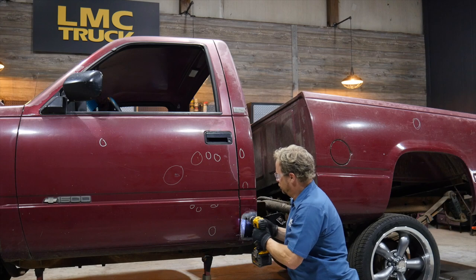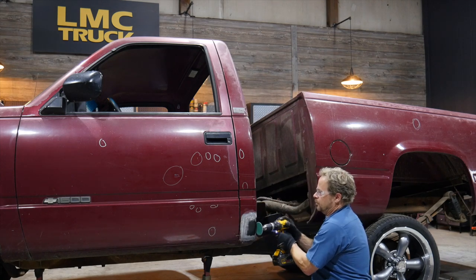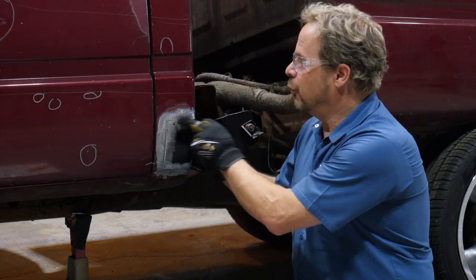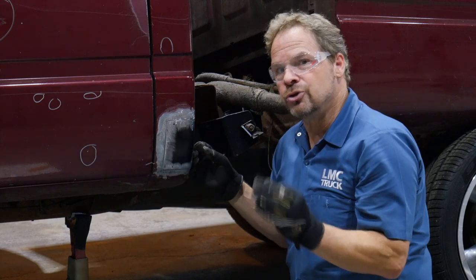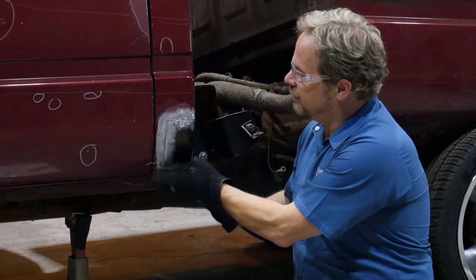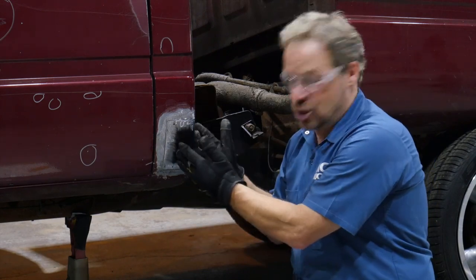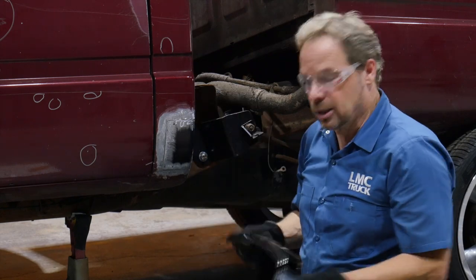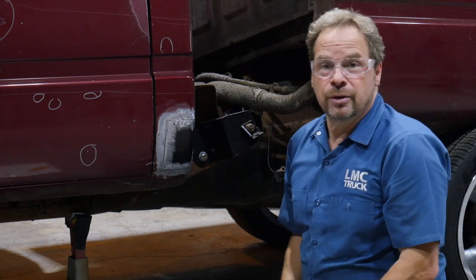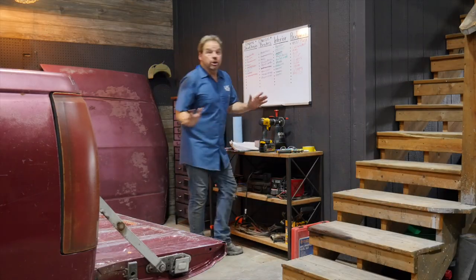After another solid 20-minute wait, we pulled the sheet metal screws out and, using our 24-grit disc on the drill, ground any excess adhesive off of not only the gap between the patches but also the outside edges. We still have to use a fiberglass reinforced filler for the gap, and you don't want to use your glue for body filler — it's not for that. It'll expand and contract differently and you'll see what's called a map through the patch. So we're going to use a fiberglass body filler here and for the little holes. I want to keep as much of the original shape and contour of this truck as possible so it's easier to blend a patch in. We cut a small piece out and sacrificed a little bit of sheet metal, but thank goodness this is a full cab corner from the catalog and we had more than enough to do a proper repair. Rust repair. No welder. No compressor. We just knocked a big one off the list.